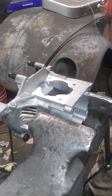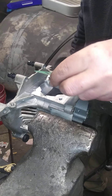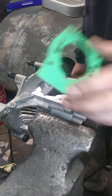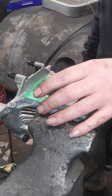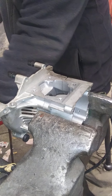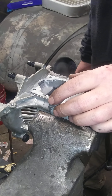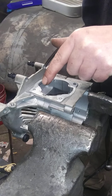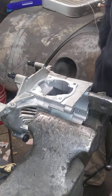I decided that I was going to gasket match the head a little bit more. To elaborate on my last video, this is what the top of the crankcase looked originally, and then I ported it out. So that's what it looked like, and this is after. I got a gasket in the mail with that cylinder head that I showed you on my last video, and I decided that there's a lot of room for improvement yet. So I'm going to show you how I'm going to gasket match this.